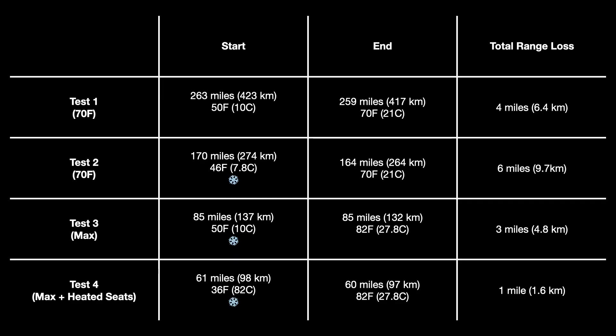As you can see from test four, if you're worried about your car completely running out of battery by preconditioning, that is not going to happen. Once it hits 21%, it shuts off sentry mode and goes into a battery-saving mode, similar to what you'd see on a smartphone. Looking at the results, it was actually the opposite of what I expected — I thought the last test would use the most energy, but it used the least. The most energy-intensive test was actually test two, the middle-of-the-road test. I'm not sure exactly why that happens.